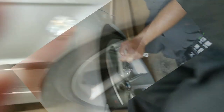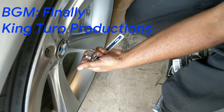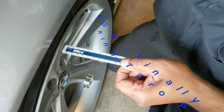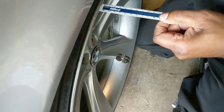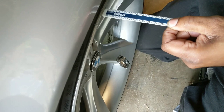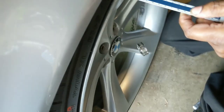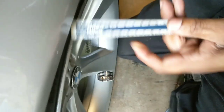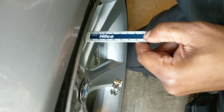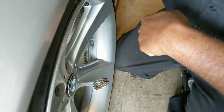Let's go to the back. I do the same thing on the rear: get my counterweight even with the center cap and measure it the exact same way. With this one on the rear, that's a 15 — I can actually do 20s back here. That's the way this tire's designed; it's a little stretched. I don't like stretched tires but that's the way they're designed. Plus with this ruler, this little tip is a couple millimeters anyway. I'm coming up with a 15, but yeah — I can do 20s on the back and 15s on the front. That's probably what I'm going to do.